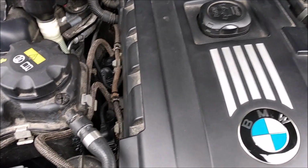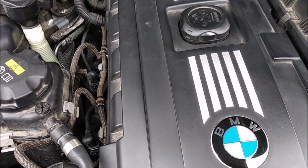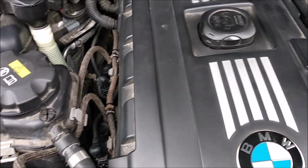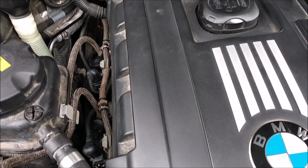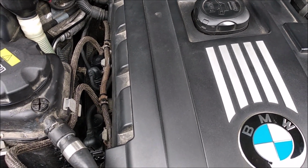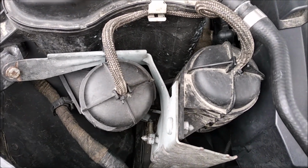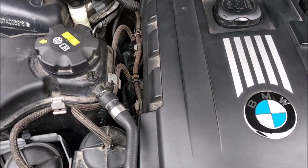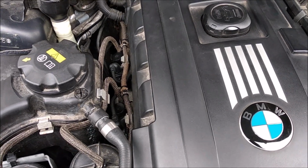After flashing my car with MHD Stage 2, I ended up with a pretty bad wastegate rattle, and I didn't care much about the rattle until I started getting a 30FF code, which means either a vacuum leak or bad wastegates. So first I did all the vacuum lines and boost solenoids. I also had to replace one of the canisters because it was cracked, but it didn't work for me. I was still getting a 30FF code when pushing it hard.